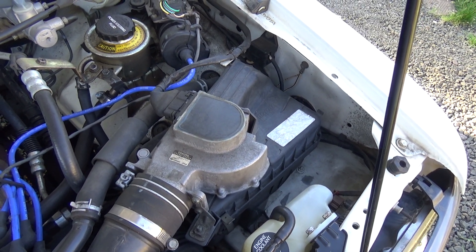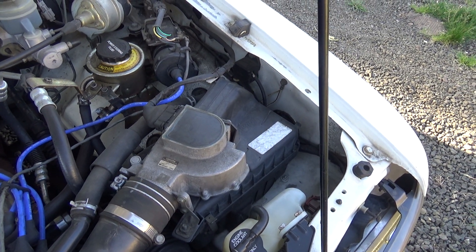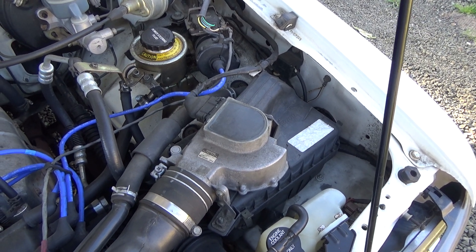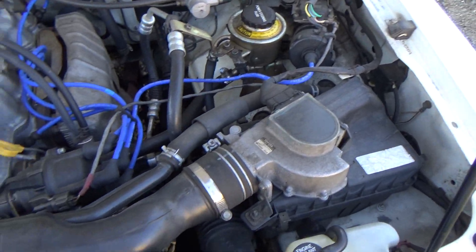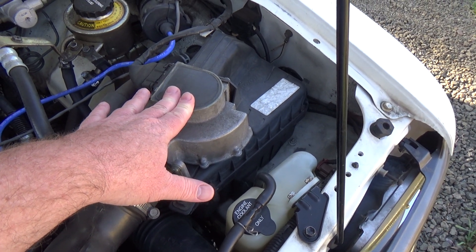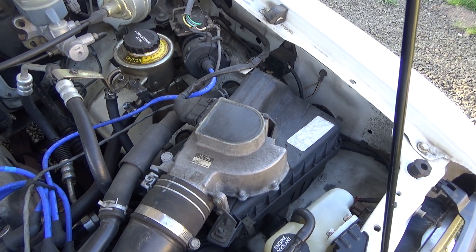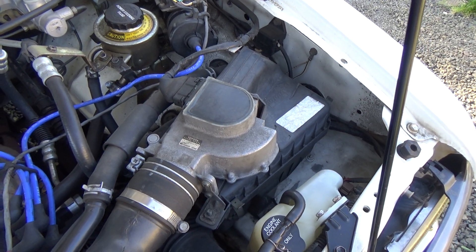He had some cleaner and was wondering if there was a MAP or MAF sensor on the 22RE. For those not familiar, like on Hondas that I usually work on, they have what's called a MAP sensor — Manifold Absolute Pressure. On the intake they have a pressure sensor, and it measures how much air is coming in by the amount of pressure built in there. I like those because you don't have to clean them — on the Honda Civics in the 90s you never had to clean anything because it was just a diaphragm type setup measuring air pressure.